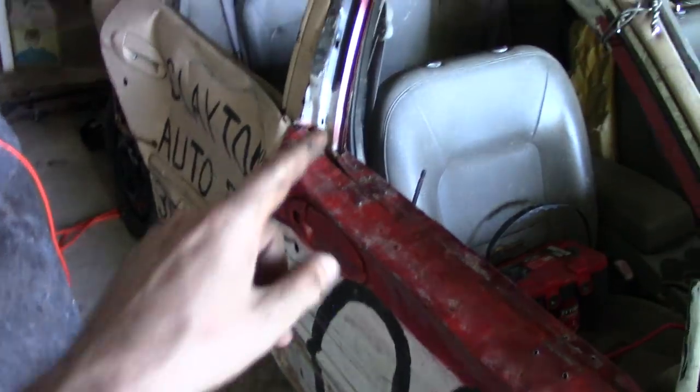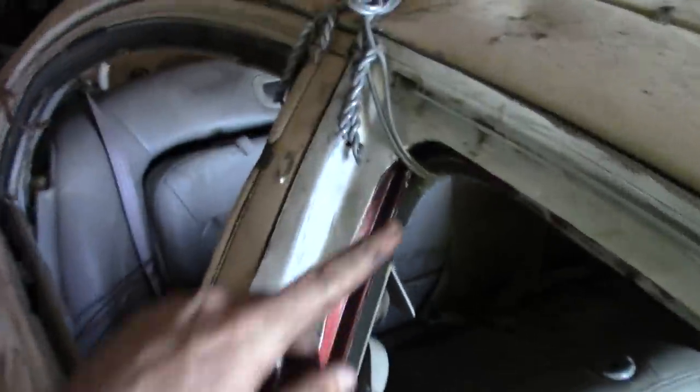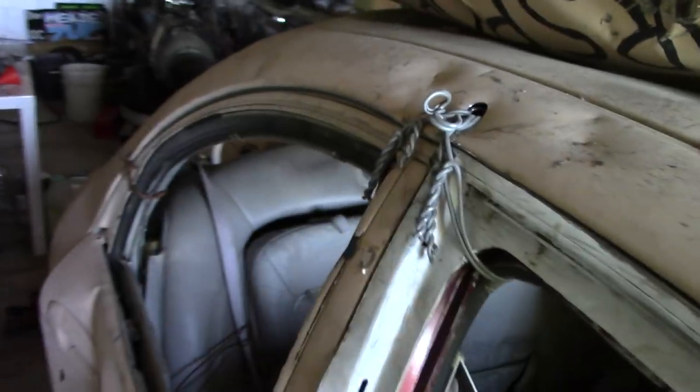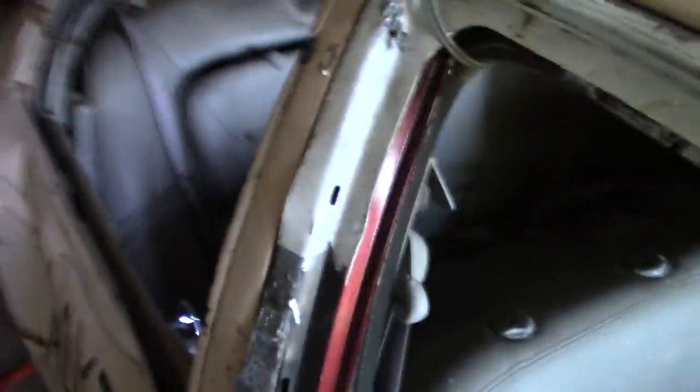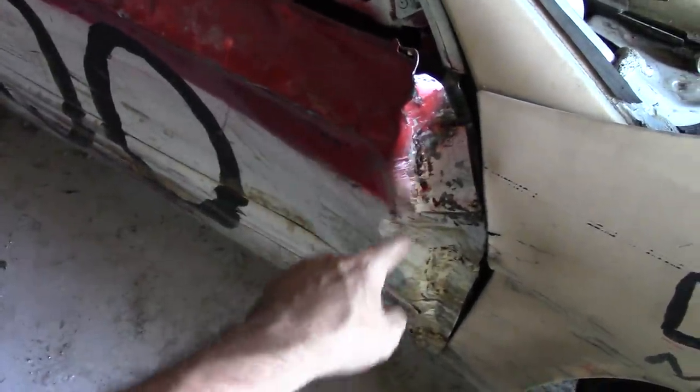Here's a tip: I put a ratchet strap around the door, around this frame, and around the window while the door was sitting on the ground. Then I put another ratchet strap in the corner and ran it all the way back to this corner. By doing that I used the ratchet straps like a crane — slowly reel in the strapping to pull the door upward to get the right height for the hinges, then crank the other one to pull the door backwards into the corner. Once I had it roughly in place I took a sledgehammer, smacked it, and it wedged itself in. Got one bolt in, then tightened everything up the rest of the way down. It's back on the hinges, latched in place, nine-wire back around the door — good to go.